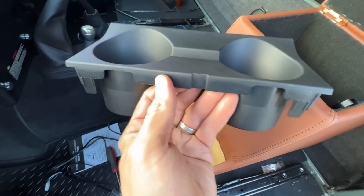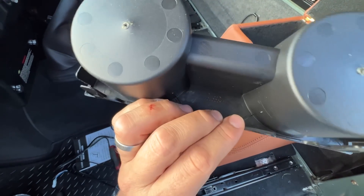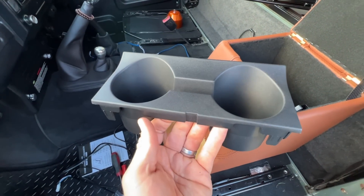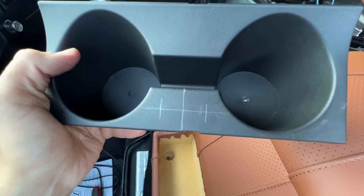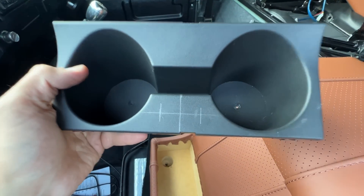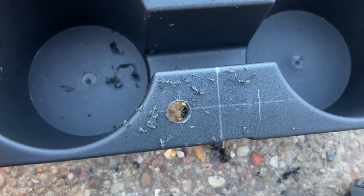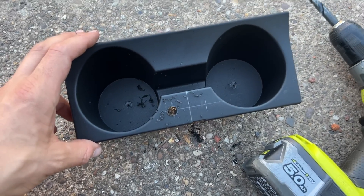This is that little flat piece I was thinking of putting the switches into, which does look quite good. It's the plastic bit we're going to have to drill into. I've measured it out — those are the two centre points I need to do to get the switches the right distance apart. The first hole is drilled — just a small one to start with, just to get the position right. That looks good. I'm going to make it a bit bigger now, and do the other one first.